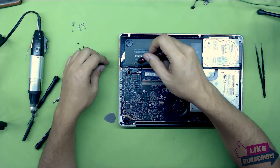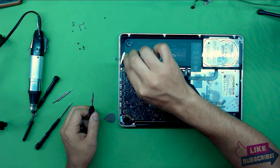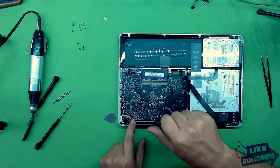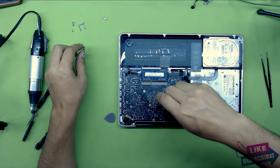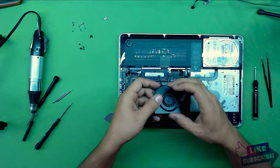Once you do those three corner screws, you want to remove this corner one — it's going to come out with the aluminum piece. It's a very small screw, put it to one side, and remove the aluminum piece, put it in the same place. Next, remove the top screw — I already removed this one. Remove the other one beside it. Remove the fan screw — this one is a bit longer. Remove the other fan screw. You can remove the fan right now: hold the cable up and the fan comes out. It can lock up from just removing the fan.